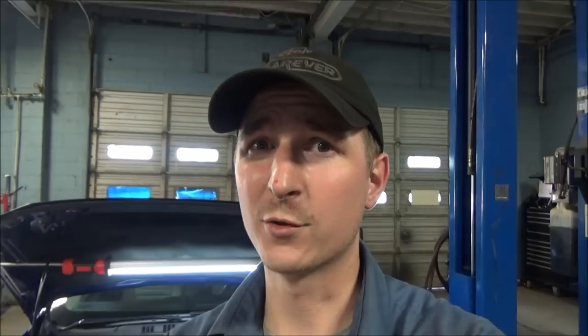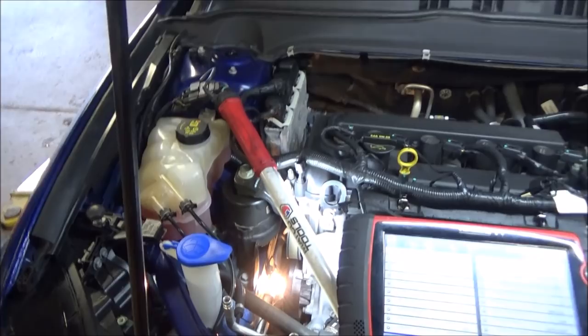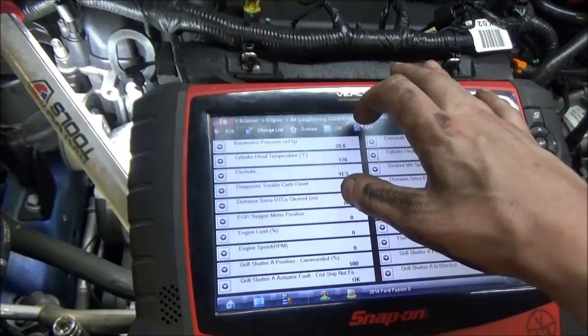As far as our initial observations — the system being low on charge — obviously that needs to be addressed. We found a few different leaks, and I still need to check the evaporator drain and other places. So definitely still have to worry about that. It's a little weird that we had two separate issues on this thing. Just to give you a number: I pulled out only 0.3 pounds of refrigerant and the vehicle takes 1.5 pounds — hopefully that emphasizes exactly how low this vehicle was. But even after getting this thing vacuumed out and recharged, we still had no AC and no compressor action. We did a few quick voltage measurements and the compressor clutch is bad. The controls are there, the pressure is not. This thing needs a compressor.